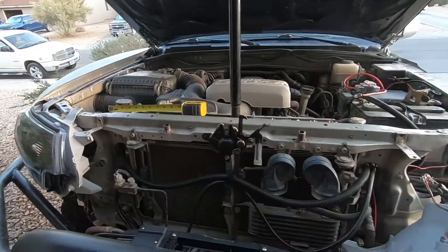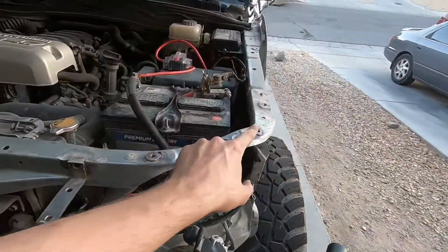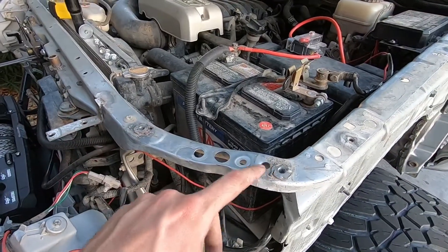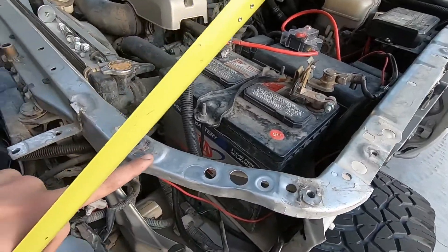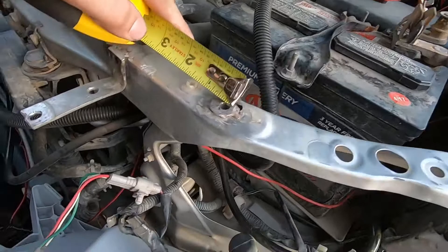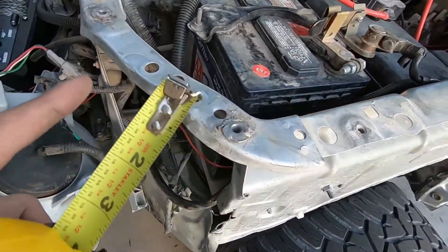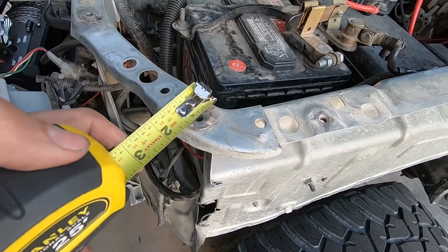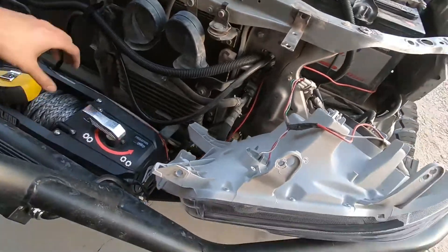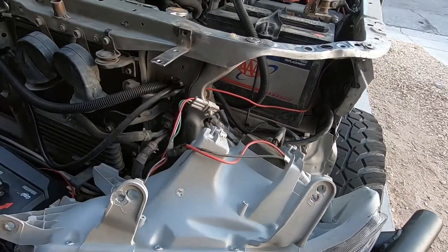Next I would recommend doing the front clip, then start with the fender flares. For the front clip, my two mounting points for the headlights are here and here — I think these are the original OEM mounting points, just a little off center. This is the hood bump stop that came with it. To give you a measurement: it's an inch and a quarter, basically dead center for the left side. For the right side it's a little further down — about three quarters of an inch down. It's not going to match the original mounting points, so you're going to have to do two mounting points kind of off center to get it to line up.